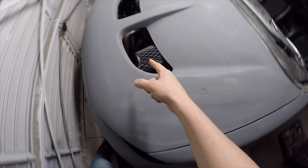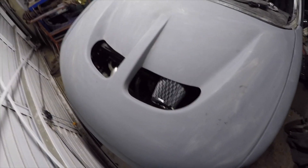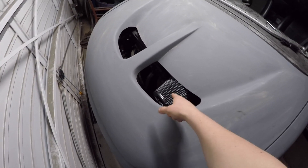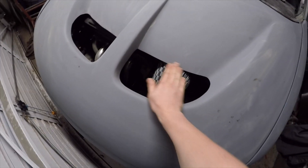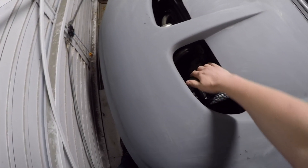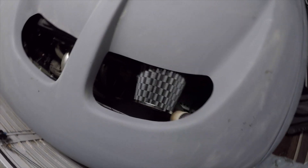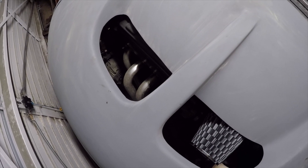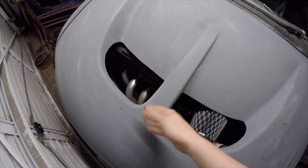So let's see how obnoxious and screwed we are when we actually close the bonnet, because I think that's going to be a different kettle of fish. Okay, I think we might be kind of screwed. I mean, it's going to get cold air - I suppose that's what it's meant to do. Maybe it'll come over the top here and get sucked in. But that is just going to be effectively a bucket for all the rainwater, which is not particularly what you want with an air filter. But I suppose what we could do is make a shroud for it - effectively like a chrome piece that sits over the top of this cone - so the rainwater would hit that and dribble down the outside. Looks like a little bit of work to do.